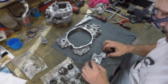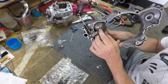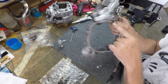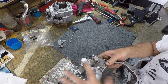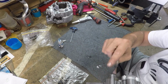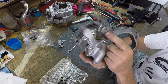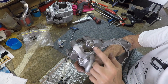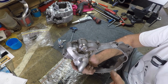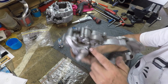Alright. Okay, bloody GoPro battery went flat on me. So I finished this. This is, like I said, power valve actuator, water pump on the other side, all nice new button head fastenings. This is actually, so that spring there. That spring is the adjustment that I was speaking of in the last episode, where you can sort of tame the engine down, or you can make the engine crazy aggressive, just by taking pressure on or off of that spring.